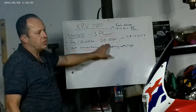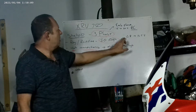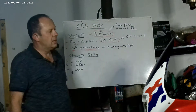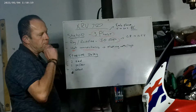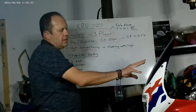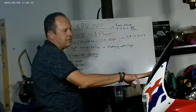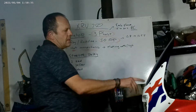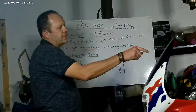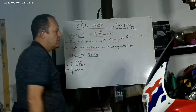You do get 35 amp units - they look the same but they're not; higher rating is better. Full charging on these bikes varies from 13.8 to 14.5 volt. If you want to build in a voltmeter on your dash panel and connect it to your standard lights, you might see a difference in voltage. It'll show 11 to 12 volt, but if you check it on the battery itself it's actually 13.8 to 14 volts. Just make sure on that - don't get confused.